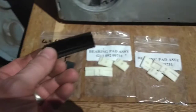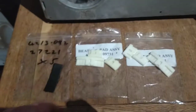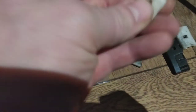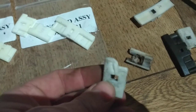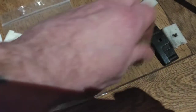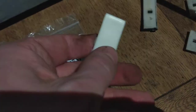I'm going to replace them - I've got a new set. To be honest I don't know what the difference is between the black colored ones and the white colored ones, but I thought I'll replace like for like. So I've got essentially two sets of bearings. These are the old ones - you can see there's quite a bit of wear on some of them. Others are basically fine; that fault is from when it was molded - probably injection molded. There's another one with a fault but no wear on it. That larger white one is worn - you can see where it's shiny, almost polished, whereas the new ones have an almost matte finish.